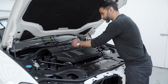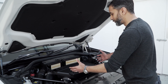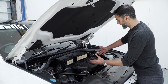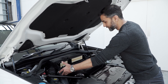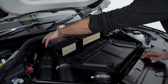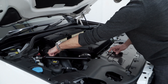The strut brace has already been removed, so I'll show you the airbox. As you can see, the airbox sits on top of the engine and it's very different to what we're normally used to. You've got four filters integrated into the top and two air feeds — one on this side which feeds from the front, and the other air feed right here which also feeds from the front just behind the grilles. The air goes into the middle section and is then sucked through the filters into two separate chambers, which then feed separately into the two turbos.